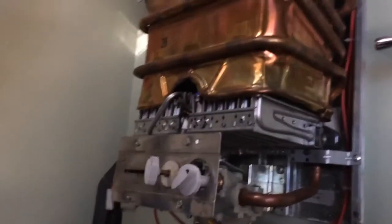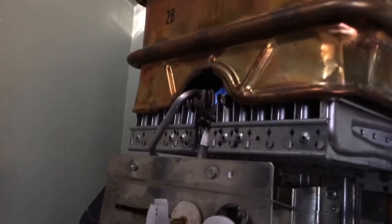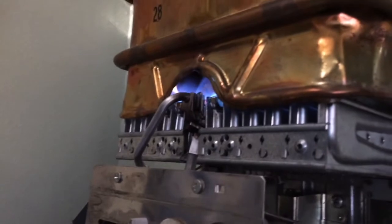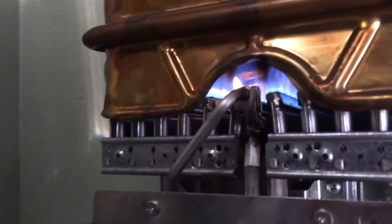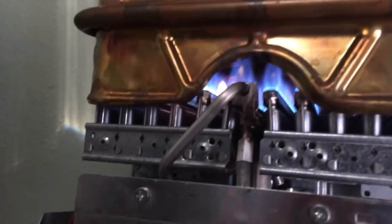Now that we have the cover off, you can see the pilot light right there. I'm going to turn this on and you'll be able to see that one of the burners has quite a bit of yellow flame to it — there's even a tall yellow one towards the back. That's no good, that's a lazy yellow flame. It should be bright blue and hot. Over there you can see a very blue flame with no yellow at all, except for little sparkles from dust particles burning off. That yellow flame is no good — we're going to try and fix that.